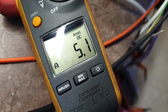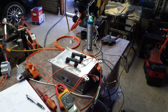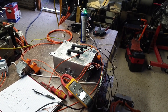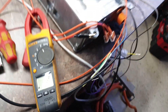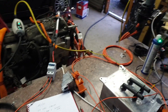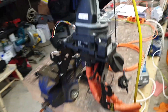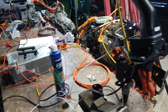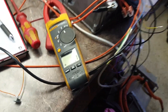Unlike the previous times, we're going to keep on trucking — of course, now that I say that on camera, it'll probably make a liar out of me. But anyway, this is the first time we've got the VW charger working and not erroring out on an interlock. It is charging, and that charge is going back through the CHAdeMO cable and out the land yacht's tailpipe. We're still using the CHAdeMO charging port, but I got the LED wiring correct so I'm getting the right color coding on the LED.